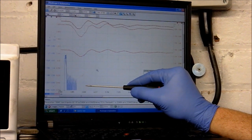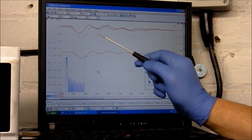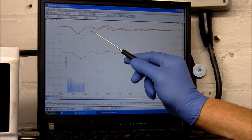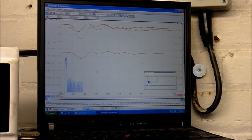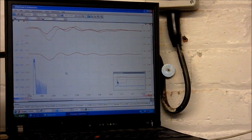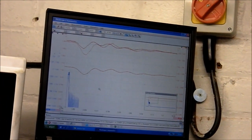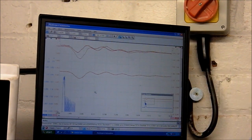You'll be able to see as I increase the pulse time — there, you see it increasing. And you can see it's opening the injector. And like I thought, that one is quite a bit out. So even though we're going the right direction, we're still not able to get there. But by looking at everything — everything's working now. I'm pretty certain it's a calibration fault, it's not a fault of the parts we fit. So what we'll do now — I'll adjust back to one millisecond with our normal test figures. And I will adjust the timing of the injector by adjusting the injector itself. Let's see if we can get that profile bang on.